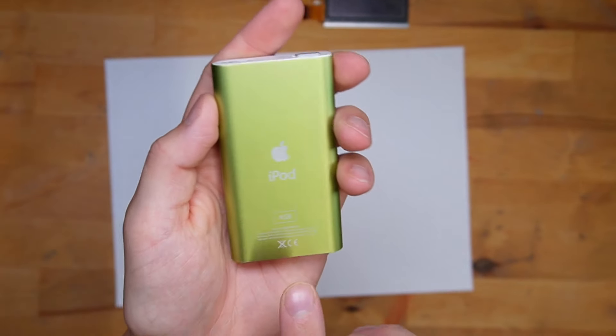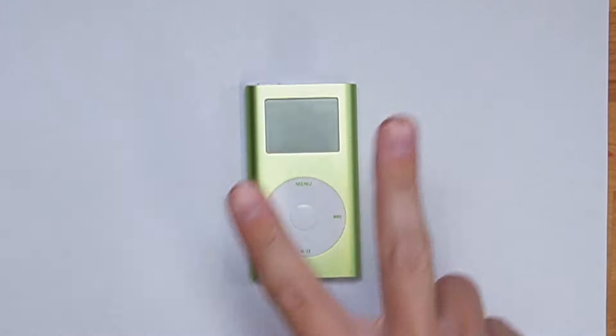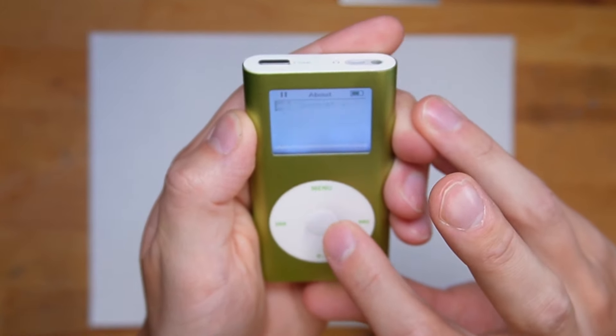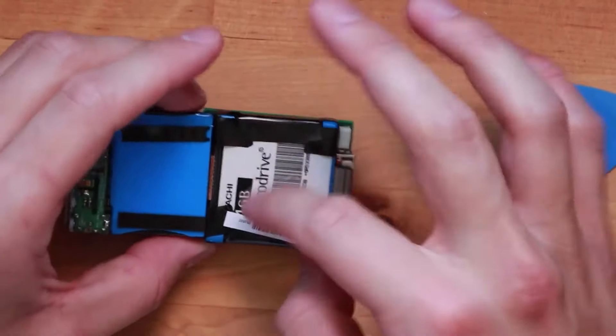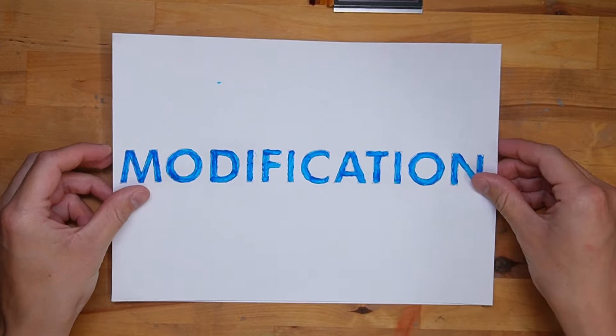If we take a look at the back right here, what you see is that it has four gigabytes of storage on it, which means if you're an audio enthusiast, you can just about fit two songs on this, maybe one if it's Bohemian Rhapsody. But what if you wanted more than two songs? If I go right here into settings and then about, what you see is that this iPod has about 120 gigabytes of storage. And that's not because I found some shady website to download more storage, but because I actually opened this thing up, took out the original four gigabyte hard drive and then put in a brand new 128 gigabyte micro SD card. I did a modification.